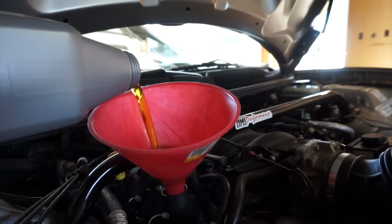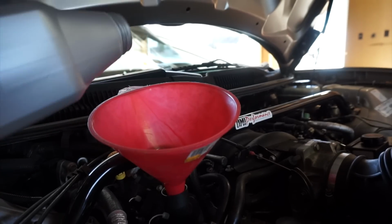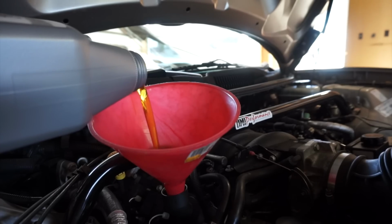So I got my flashlight out. I'm kind of looking around for a second or two while it's running. I was ready to watch the drive system. Then the harmonic balancer fell off. It was banging against the steering rack. So I wave him to shut off the car immediately, and he shuts it off, and we look at it real quick. And sure enough, there's an ARP crank bolt in it. That bolt backed out so far that it was only finger tight, and the crank pulley, you could just wiggle it around. It was off the crank snout.